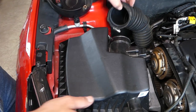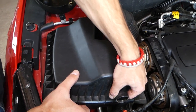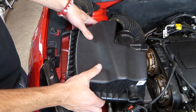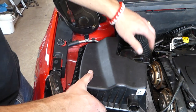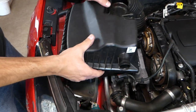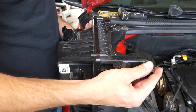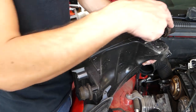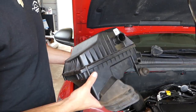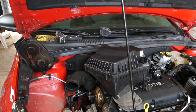The air box is held by just a couple of rubber bushings — grab it with your hands. There's also one more small hose on the back to disconnect. The rubber bushings are on the front side and the back side — those are the only things holding the air filter box in the car. From there it slides into the fender, and it just comes right out.